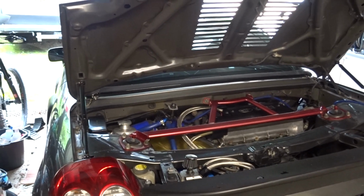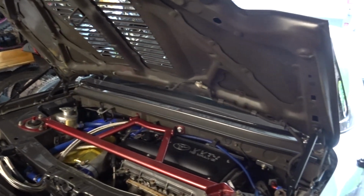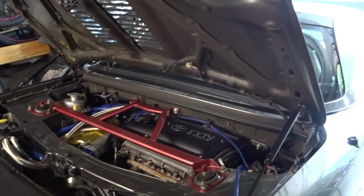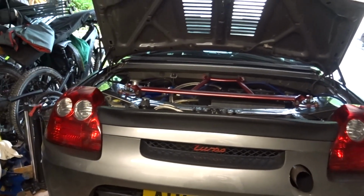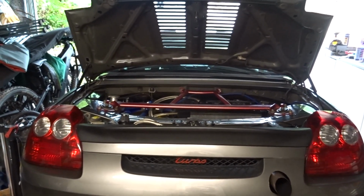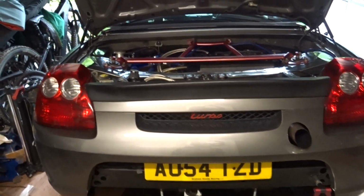We didn't really get out on track where it was properly dry. So I think when we swap the engine over the winter, we'll develop a front splitter for it and see how that sorts that out. Because I think with the flat floor and rear diffuser, I'm probably a bit biased towards rear end grip now. And we'll have a look at the tyres, and maybe we won't cheap out, we won't mismatch next time.